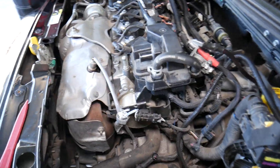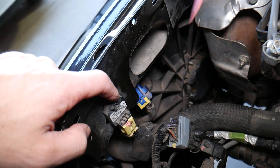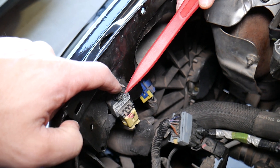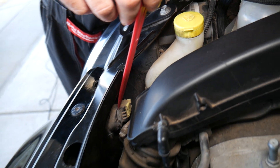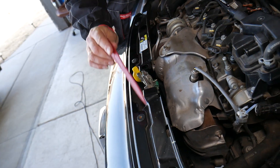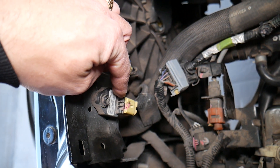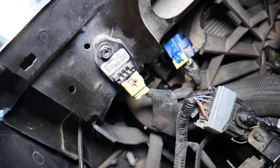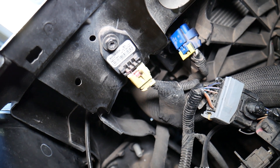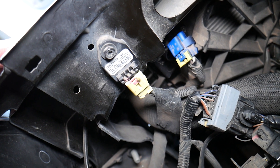When you do all that — again, if you're not certified and qualified, don't work on it. But if you go to the radiator support on the back side, you will notice you often have one or two crash airbag sensors. This one has two; most cars will have two — one on the driver's side and one on the passenger side. Sometimes they may be behind the bumper on the radiator support on other cars, or on the front side of the radiator support behind the bumper where you cannot see them. Usually the connectors will be yellow on the airbag sensor so you know it's an airbag sensor. Disconnecting them will be different depending on the car, so if you want to see how to disconnect a Fiat airbag sensor, you can find that information on our channel. They have different connectors and different designs, and you need to know how to do them — otherwise you can severely damage them.